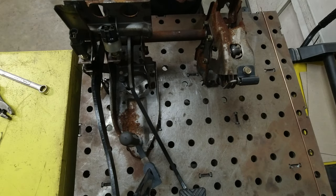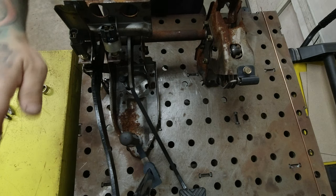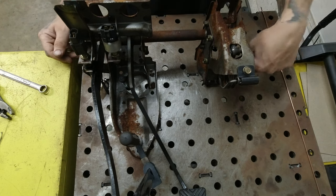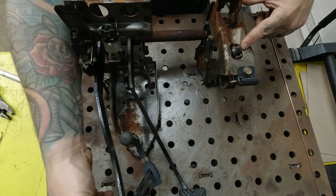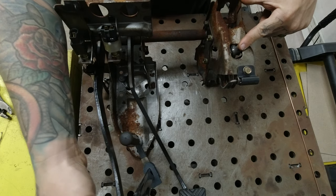I'm going to try to demonstrate what went wrong with my clutch pedal here. I've got everything set up on my welding table. The clutch pedal is over here and over here is the clutch actuator Z-rod — it needs to push this way. Here's basically what went wrong: you can see I'm moving the clutch pedal, but the Z-rod is not moving at all.